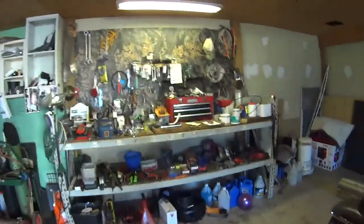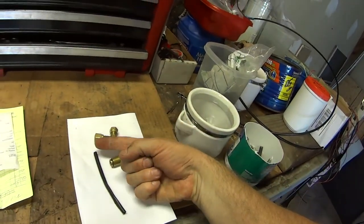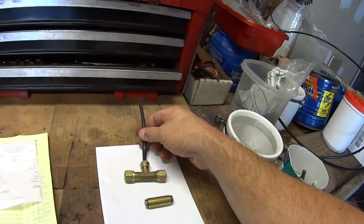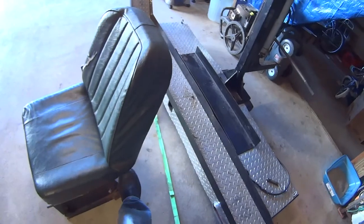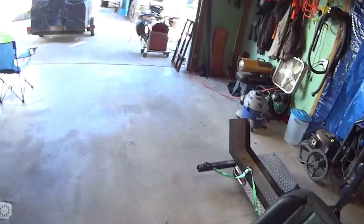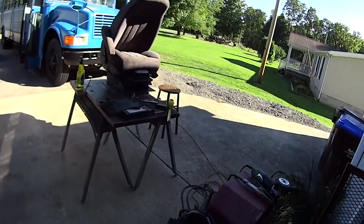What I had to do was buy a couple of fittings. This is a T fitting — there's already an existing air line under the dash that I'll cut. I'll put this in, and then I bought some air line that I'll hook into it, and it'll go to the seat. That'll make things much more comfortable. I am going to have to take this bracket off because that's where the seat belt bolts on, but other than that it's pretty much done. I'm going to get some paint on it and be good to go.